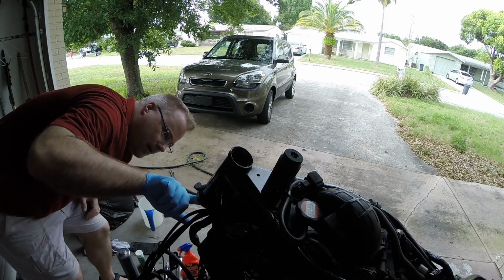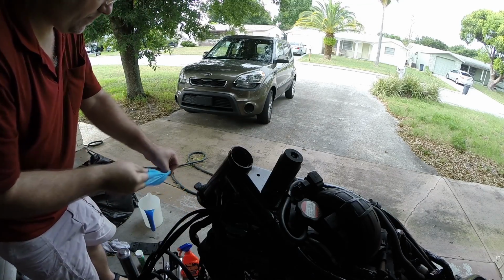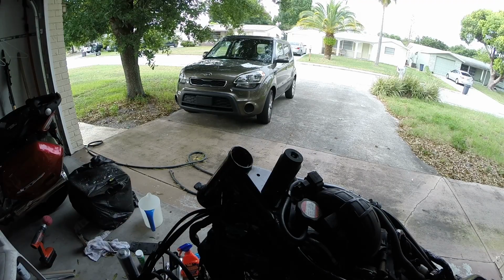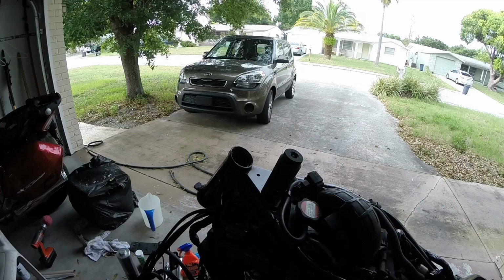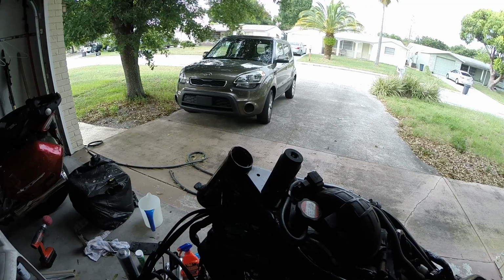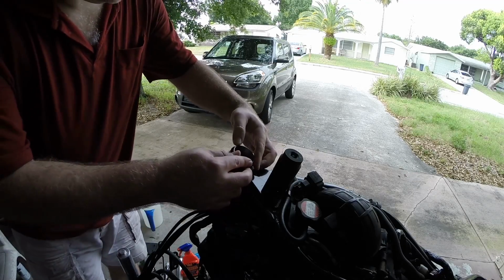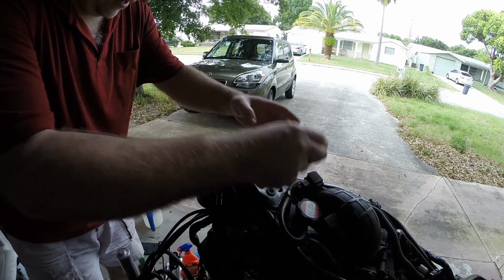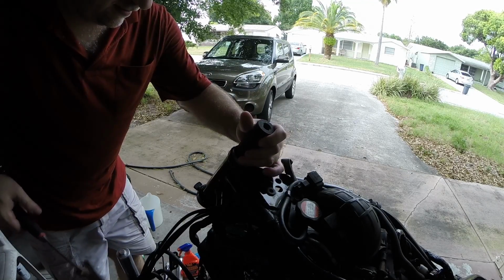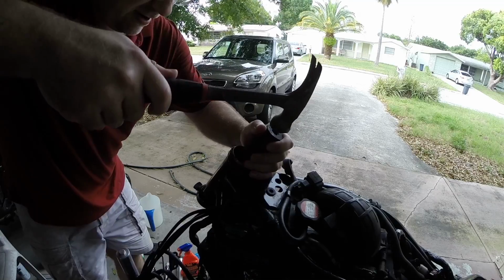Put the grease in the bottom here. Alright, it's ready to go. Let's give it a shot. Thick side facing in, work quickly. Freezer didn't do a dang thing, it is solid. Quite the interference fit for these bearings. So I'm just going gently, side to side, driving it evenly in.